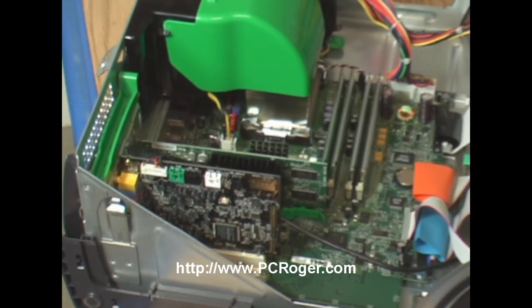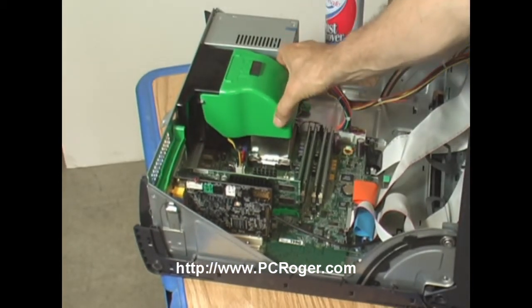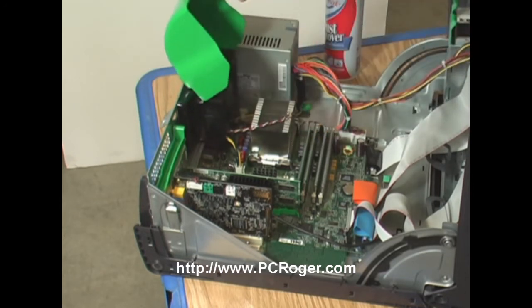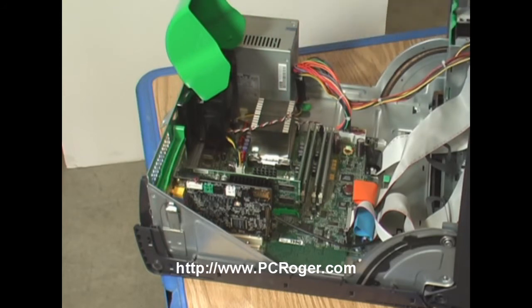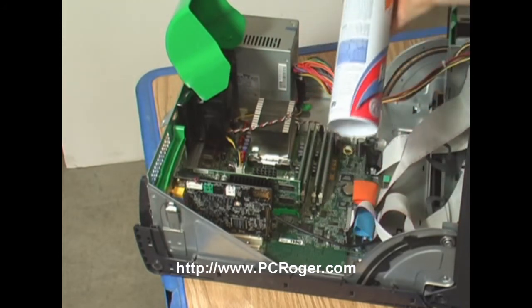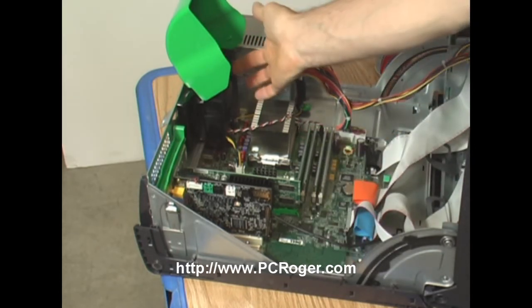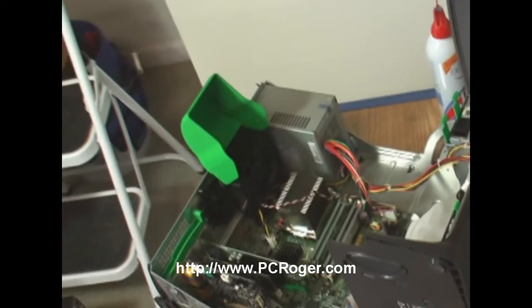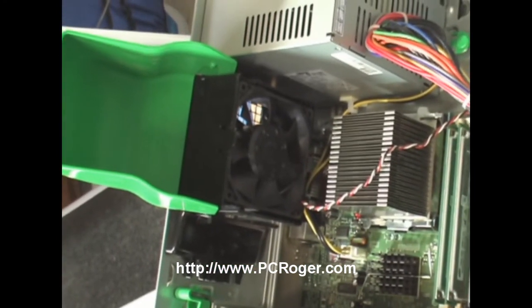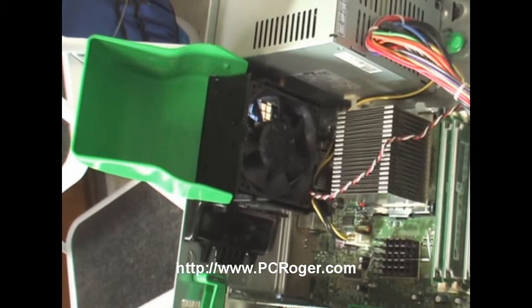Now you will need to know that some of these machines do have shrouds, like this green shroud, and there can be different ways of unlatching them — they usually hinge in some way. These fins here need to be clean, and you can blow air in through those vents to direct it in there to get the dirt out. There's also a fan in the back that is designed to pull air over those cooling fins and keep the CPU at the temperature it's designed to run at.